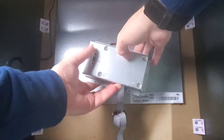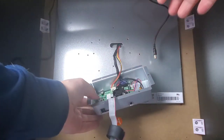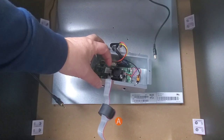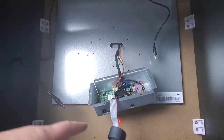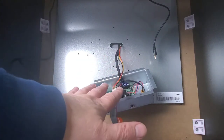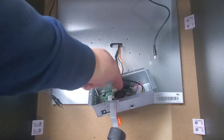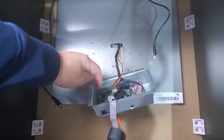When you take this off, the best way to find out if the wire was interfering with the fan - what happens is when this goes up, this wire here goes down and brushes into the fan, and that's what's creating that buzzing. To double-check, leave it hanging like that, plug your power cord back in, don't touch anything, turn your power back on, and if it now runs quiet you know for sure that the wire is bent down into the fan.